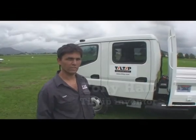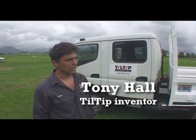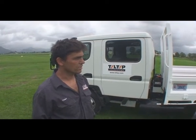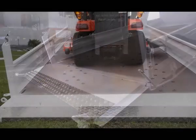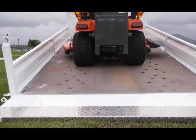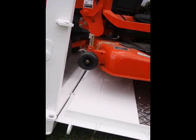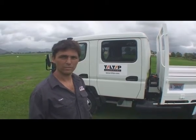We've now been able to utilise our tilt tip tray system on a dual cab. To do that, we've refined the mechanisms under the tray, shortened the tray itself, and to compensate for the shorter tray we've utilised the drop-down tailgate as an extension of the tray to give us lower tilt angles for loading and unloading things such as lawn mowers and line markers.